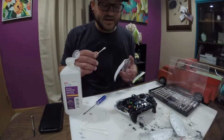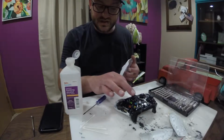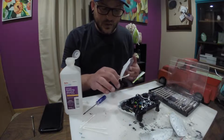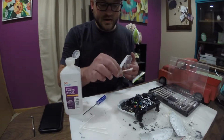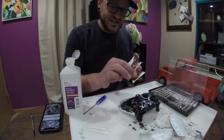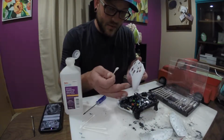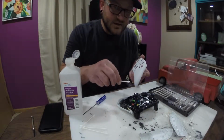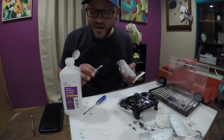I had an issue with my kids where they had a drift problem where it wouldn't snap back or it wouldn't read where the joystick was going. I actually took all the innards out, opened up the module that controls the joystick's direction, and was able to pop out one side of it, get some alcohol with a Q-tip down in there, clean it out, and that fixed all the problems. It was amazing.